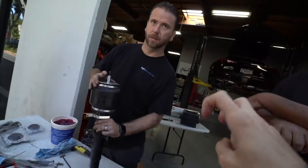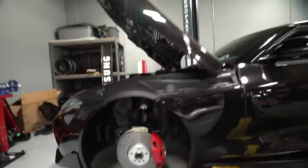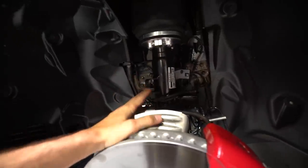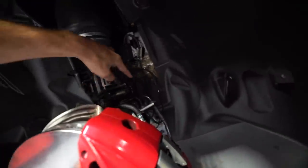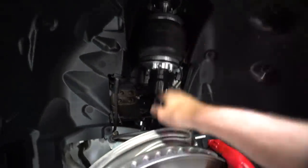This is the first time they've ever had to build the bags themselves because every strut they've gotten before was already assembled. Rears are complete, and so are the fronts - and it looks so clean. Notice that because we have the factory strut, everything is exactly the same, meaning we're able to keep all the plug-ins and the same wire management because this car has a lot of modules on it. So all that stuff gets to plug back in, no harm no foul up here in the front. Super clean. Now that all the struts are done, it's the AccuAir part.